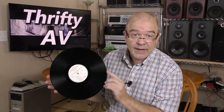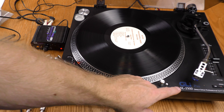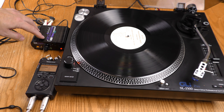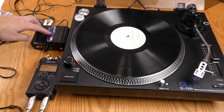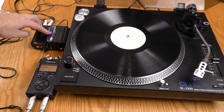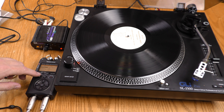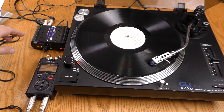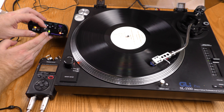Now that this record is clean and dry, it's time to put it on the turntable and record it. I have it on my GLI Pro SL2500 with my Shure cartridge. I'm running it through the Artcessories USB Phono Plus, but I'm not using the USB feature because that records 16-bit audio at 44.1 kHz. I want to record 24-bit, so I'm running the output on this preamp into the Tascam DR40. Before I do this for real, I want to set a level. This level looks pretty low — I'm not seeing any clipping at all, so I'm going to turn up the gain.